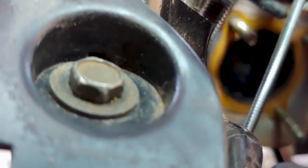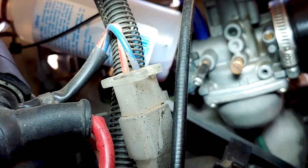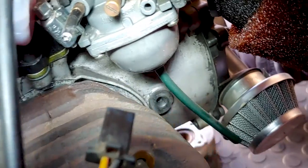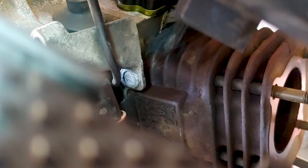You can see there's a lot of carbon that's fallen off into the bore — obviously if we were going to reuse this we wouldn't spin the piston randomly. A little bit of carbon but that's normal. We're giving the barrel base and the crankcase a quick wipe with a mountain bike brush just to get rid of any sandy residue that could fall into the engine. Kevin's diligent — this thing is pristine.